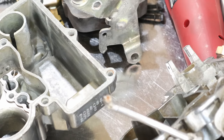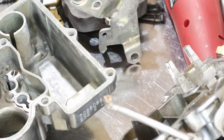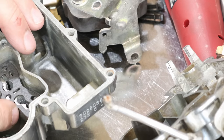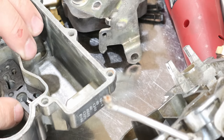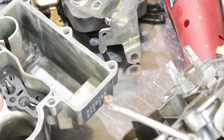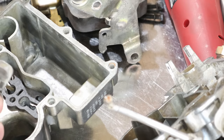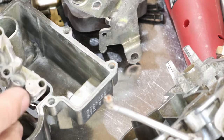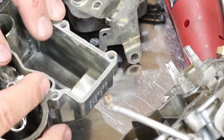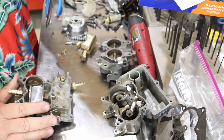Now the other big gasket you're going to have here, let's see, we're going to use that little gasket next. Right here. That fits right here. Lines up just like that. You're going to put your venturis with your meters on them right down in here. That's all right down in there. Looks like that. Sorry, I didn't have you in the shot there.